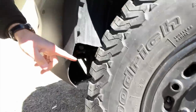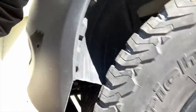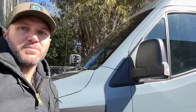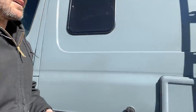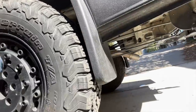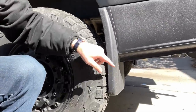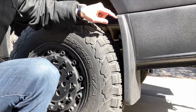You see how cut out this is? The side of the bumper is trimmed; you've actually removed some of the inner fender there. That's all been done on this side. Now I have to repeat that on the other side — I didn't cut the other side out for the 35s. And then way back here on the back — oh, new ladder — you see how close that mud guard is to that rear tire. The Van Compass kit is actually going to allow us to move this back too. So what I've got to do is take the wheel and tire off, take the mud guard off.